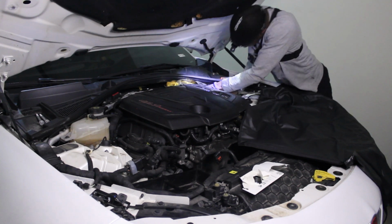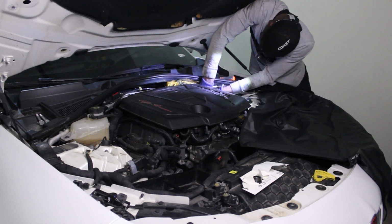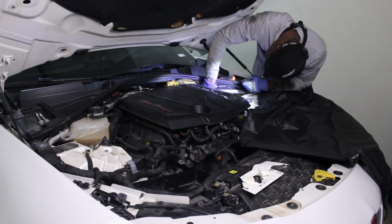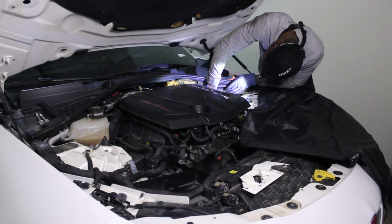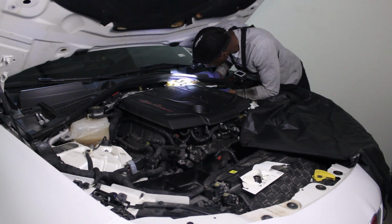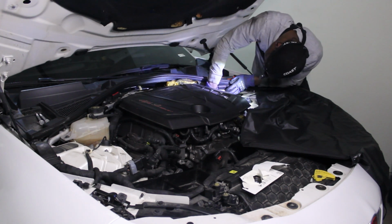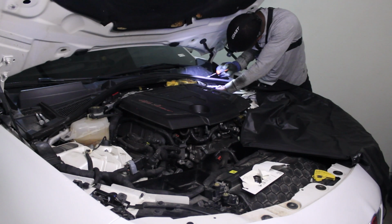When it comes to the alternative repairs, the majority of the time, instead of replacing the whole hose, one may need to just replace the plastic bleeder screw. But what happens if it breaks? Well, many have expressed how they have had success with heating a screwdriver and then melting the rest of the plastic screw enough to twist it out. I did try this, however I was not successful and did not want to try again with fear of the installation being above my skill level.